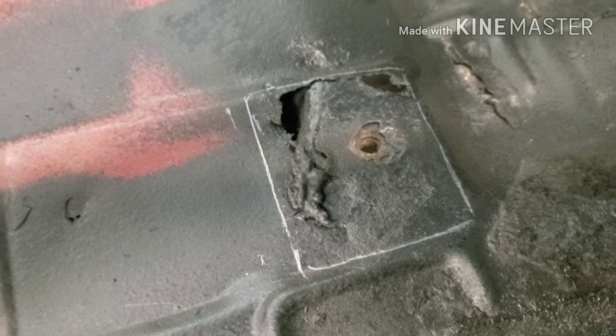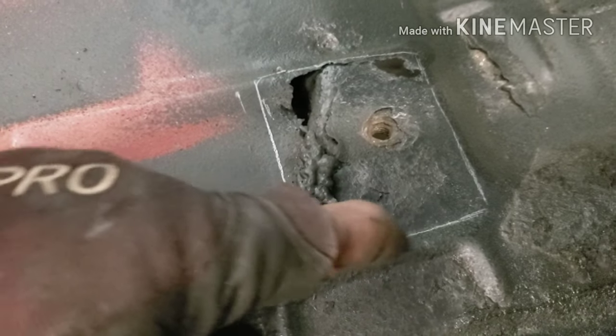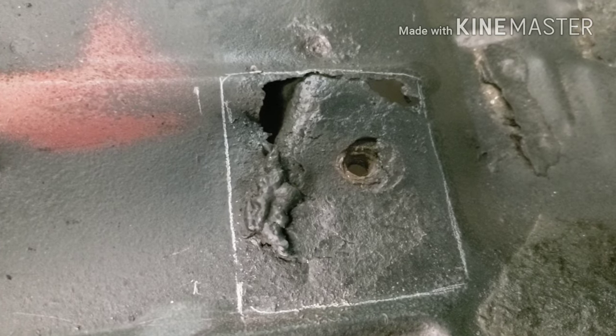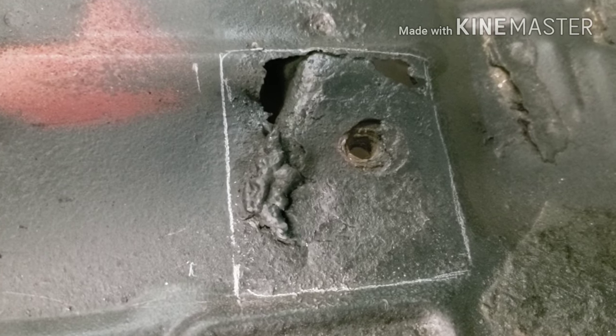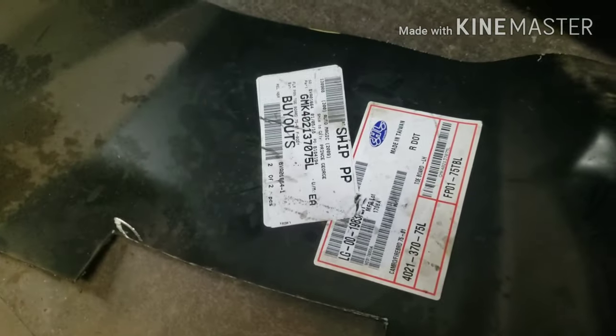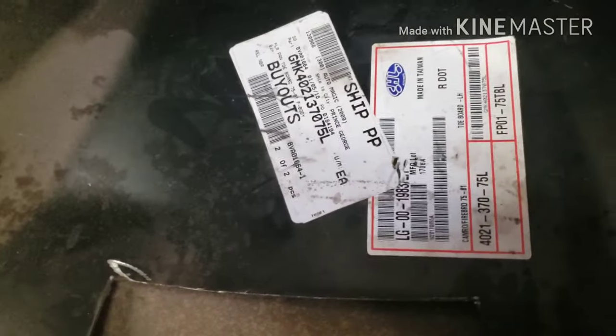It's easier to hide things and it's just good practice — if you're doing bodywork where people can see it, use the manufacturers' lines and hide all your seams. That way when you do something more critical, you've got the habit covered. I'm gonna cut that out and make a template from this piece I used when I was working on the Camaro replacing floor sections — it's got some nice big flat spots I'll use to cover the repair. I'll make a template, cut it out, weld it in carefully, then paint it and we'll be done.